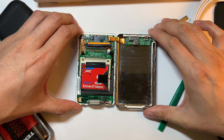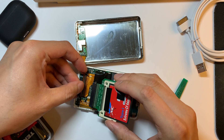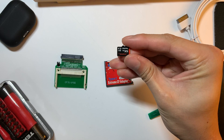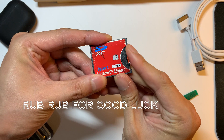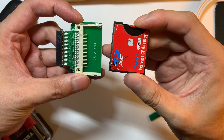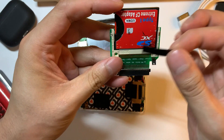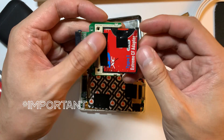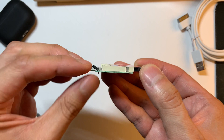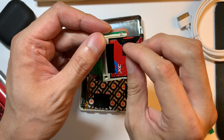I'm going to pull out the flash modded assembly to show you guys in detail. This is the CF to 50-pin adapter that holds the CF adapter with the memory card in place. Here are the three components I mentioned earlier. To install these components, take your SD card and stick it into the compact flash adapter. Once you have that, take that combination and insert it into the 50-pin IDE adapter. At this point you should have removed the old physical hard drive, and now you're going to replace it with this new flash module. I've also added some electrical tape on the components to keep the bits in place. One important thing to note: make sure you bend this plastic module back slightly, as it does get in the way. Credit to Dankpods here, because it can actually push up the back of your screen and break it if you skip this step.